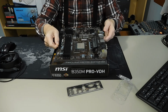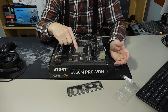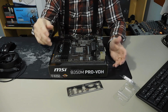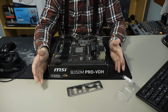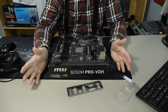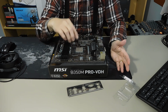Now, there are many kinds of CPUs, the Ryzen CPUs that'll fit in here. This CPU does have a 4-core, 8-thread CPU inside of it, and it's a Vega GPU that has 11 cores inside of it, so it's not really powerful, but it's powerful enough for 1080p gaming to start with. But the wonderful thing is you can upgrade it later by putting in a graphics card, and you don't have to take this out. You can just put it inside of here.